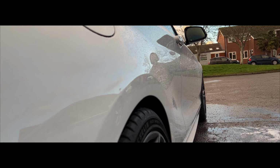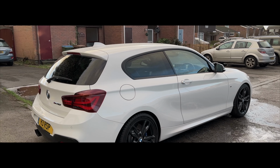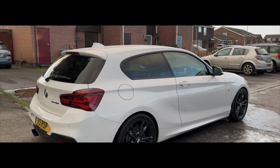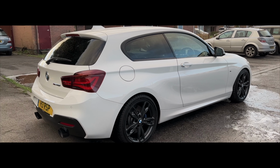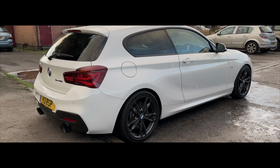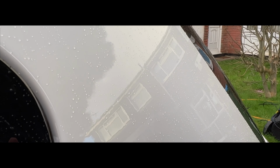You don't need to worry too much about making your paint 100% perfect or must apply it inside with special lighting. This coating can be applied outside with no problem. Just make sure you give your car a proper clean and remove all contaminants before applying. And if you have the ability to polish the paint prior to applying the ceramic coating, it will further enhance how this coating performs and looks. Gyeon's Prime Polish is a perfect product for this, and it's mess-free and easy to use. So yeah, go grab yourself this ceramic coating and give it a go yourself.